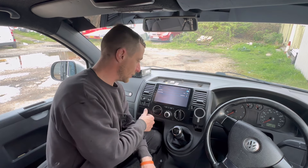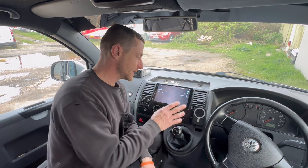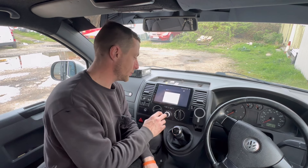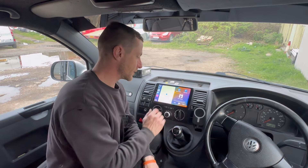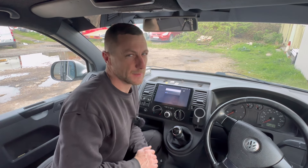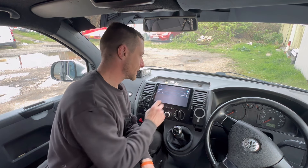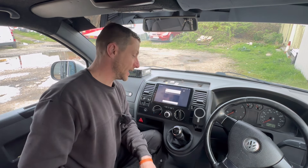Because you've got the yellow wire connected to permanent live, it remembers everything - even the last setting when you've turned it off. I leave the CP link app open - that's the app that controls your phone - and I leave the sub and amp page open. I'll probably get bored of the sub and amp soon - I doubt it. That is it. Bit of long-winded chit chat about the stereo but it's really simple.